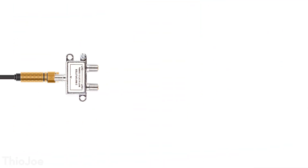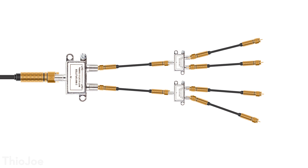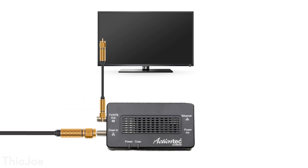And that's it — then you have a hardwired connection. If you're already using the coax cables for TV, the setup is just a bit different. The TV coax signal goes through your house kind of like branches of a tree, with the incoming signal from the cable company coming in one wire, then being split into different floors and rooms. With MoCA, you don't actually need the connection to be direct — it should work through the splits in the network, even on different branches. You go to whatever rooms you want to use for ethernet outputs, plug the first coax cable that's in use into the coax in, and then connect another cable from the TV out connection back to wherever it was going originally. Keep in mind that MoCA adapters apparently won't work if you're using satellite TV service, because they use the same frequencies on coax.